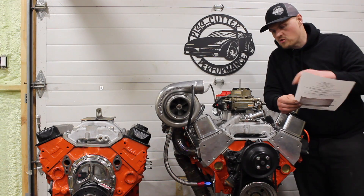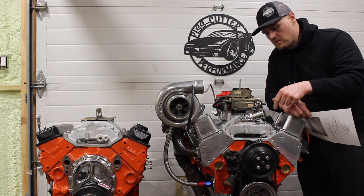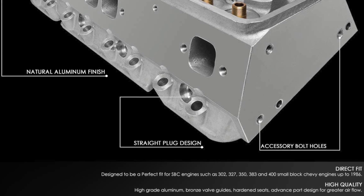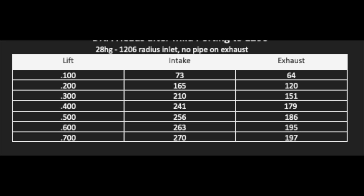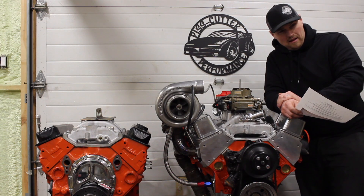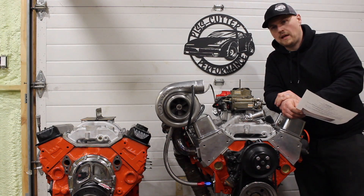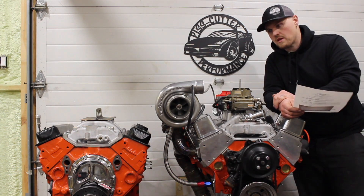The cylinder heads — I'm not going to get into huge detail because I do have a video on it; I'll put the link in the description. They're DNA aluminum cylinder heads. I originally purchased them off Amazon — I believe they were $168 a casting a couple of years ago. I did some port cleanup on them and will post the flow numbers. I didn't do major porting because they were already honestly oversized for the 2.02 valve — the throats were already on the bigger side, so it was mostly just cleaned up, fixed the irregular port shape, and opened it up to a 1206 gasket.